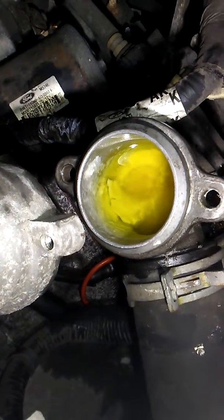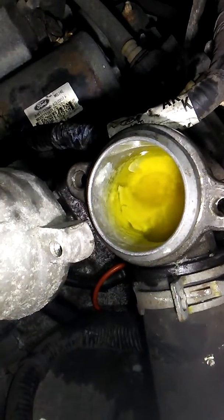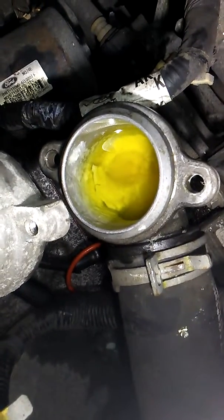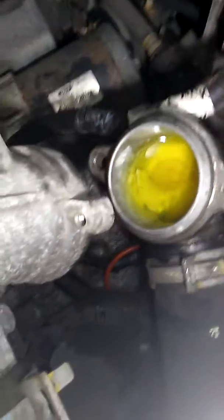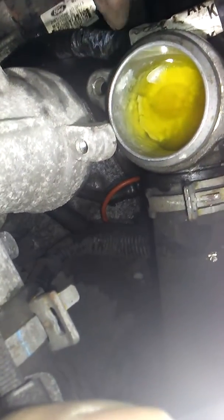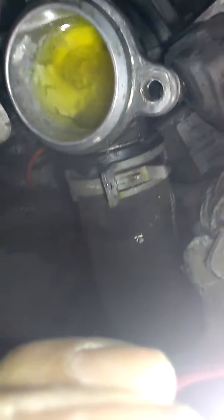What I got here is a Lincoln MKZ and I decided to go ahead and check the thermostat because both of the hoses going to the radiator were totally cold — there was no flow going through them. Look at this in here — I already stuck my finger in that. Look at the gunk. It is almost so packed, and it's just the bottom of the neck where the thermostat was. I can only imagine the reason why this thing has no flow.